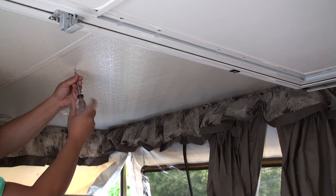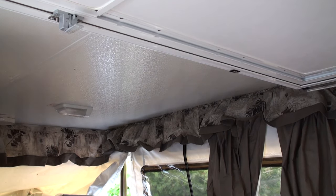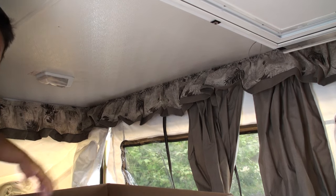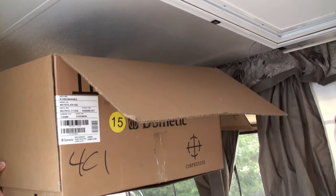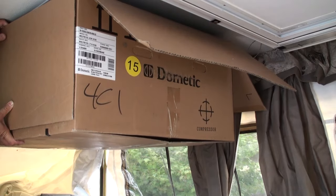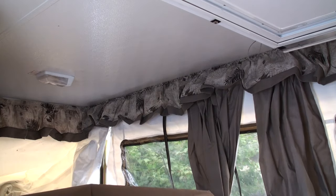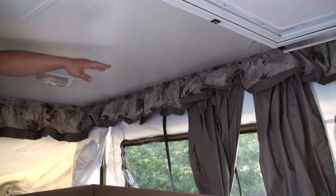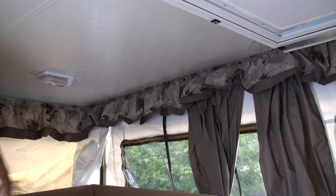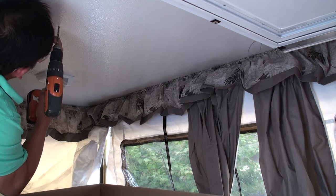Remove the marking screw and then use a large drill bit to punch a hole through into the fiberglass roof. We want to save the RV air conditioner box for later use — when cutting this hole we want the box sandwiched between the ceiling and the dinette area to capture all the dust, fiberglass, and metal shards that will fall when we use our reciprocating saw. Place the box directly underneath, put on safety glasses, and punch through the roof with a drill bit.